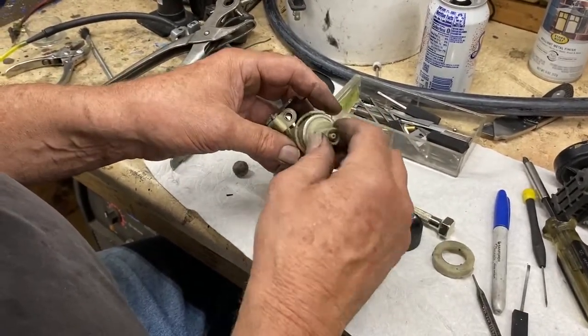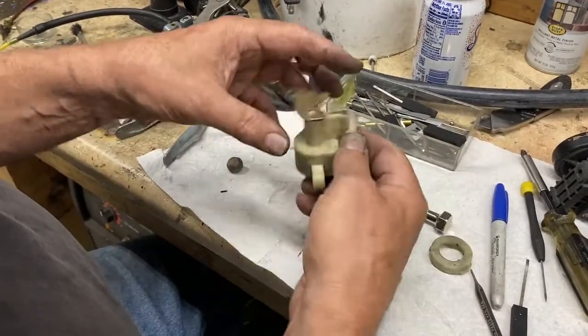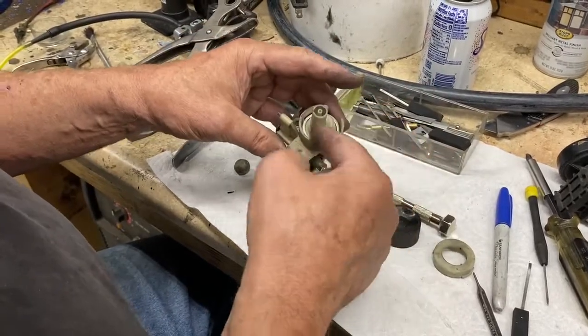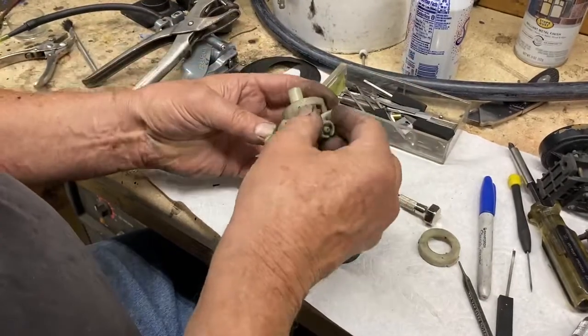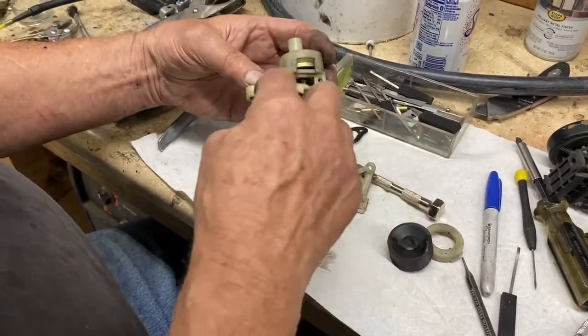This mechanism goes in here like this. This little piece you may recognize goes on the top — there are a couple of little tabs on it, and they push down and snap in here and here to hold this unit together. This is a vacuum diaphragm pod. It is sealed with an O-ring into this chamber because this switch has two vacuum ports: the one on the top and the one on the side. This chamber has to be sealed for vacuum.